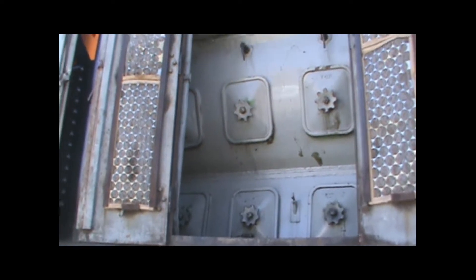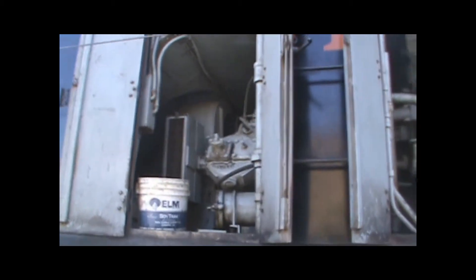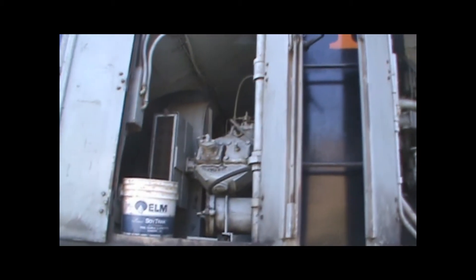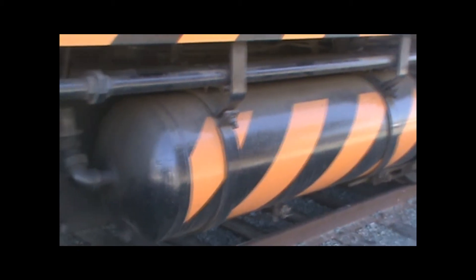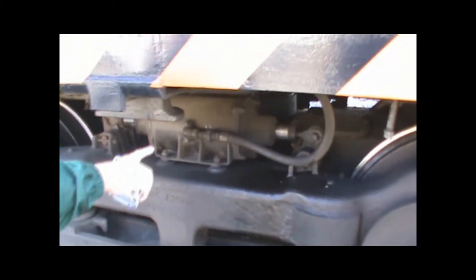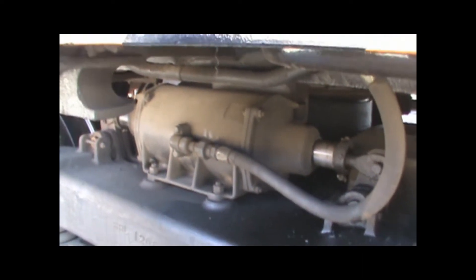Nice that you can see it — all the doors are open. And then down here at this end, we have the air compressor that keeps the air for the air brakes. The air tank is down here — that's the air tank right there. And then the brake cylinders, which are air-operated, are right here. That provides the brakes for the wheels.